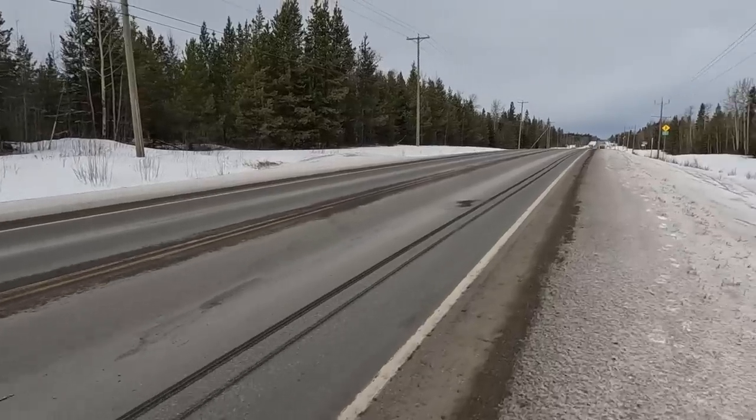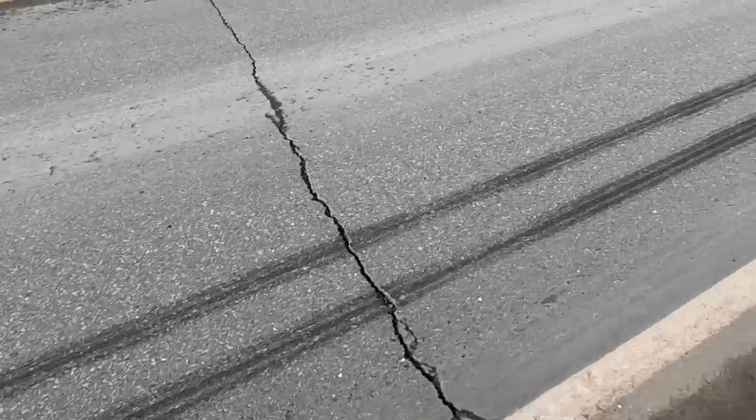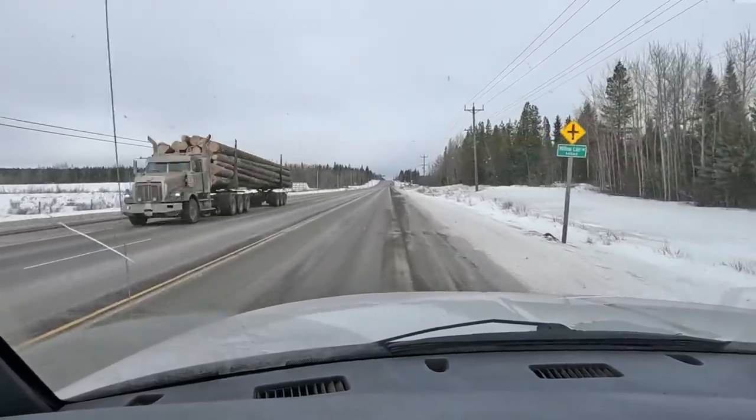Things have taken a turn for the worse. I have either my back right brake locked on or the bearings piled up — one of the two. Finally got it stopped. My poor brand new tires. We're moving though — I think it was something stuck inside the drum. Put it in reverse and it broke free. Nothing seems overly hot; the hub was warm so it shouldn't be a piled-up bearing.